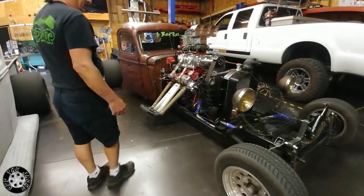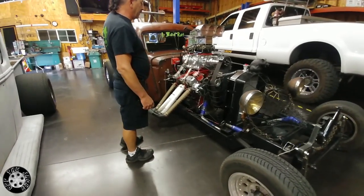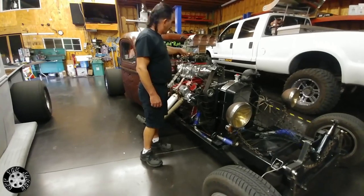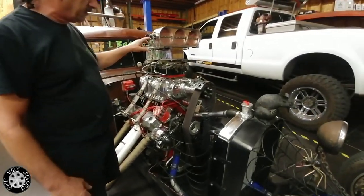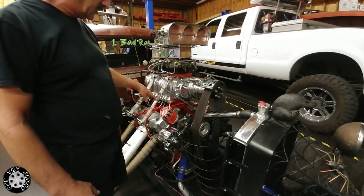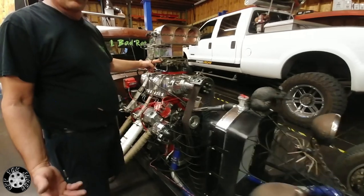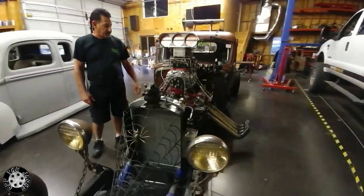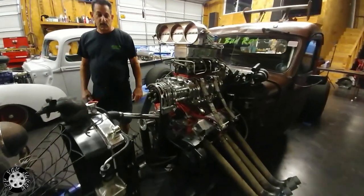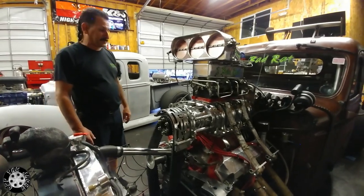I like to play around a little bit. I mean, I've got enough power but I want more power. So I'm getting rid of my carburetors and I'm moving the hat down a little bit — I'm going to have all the lines going to the hat and inject into the manifold without carburetors. I'm going mechanical fuel injection. And I'll have a little bit more fun with it, but it's still going to be just as loud — it might be more snappy.